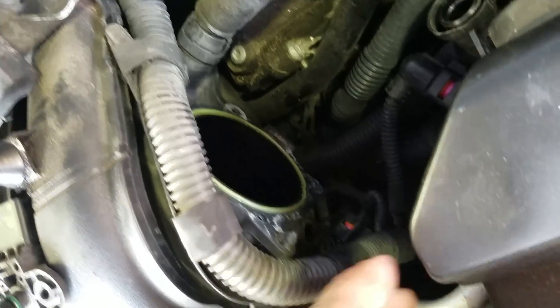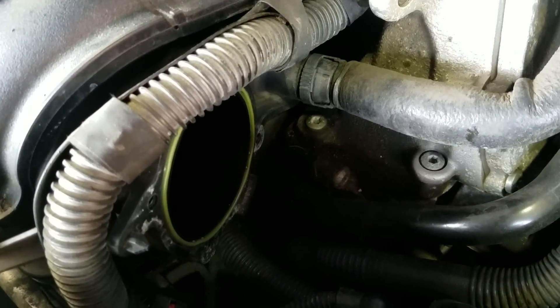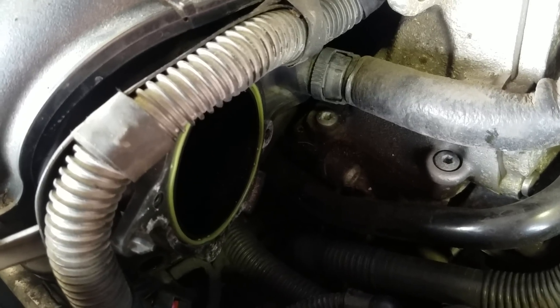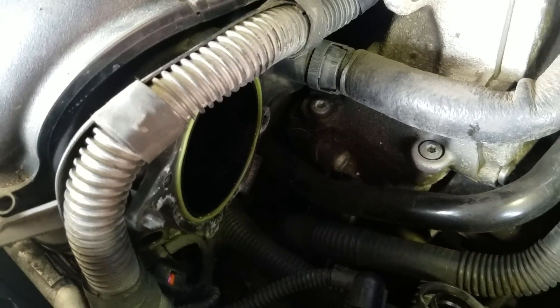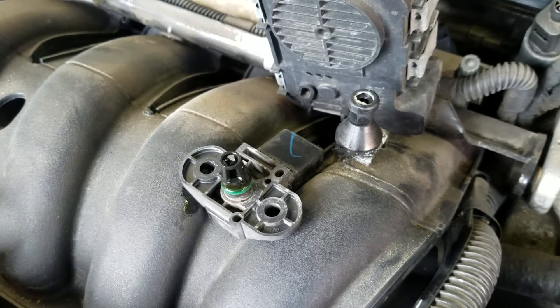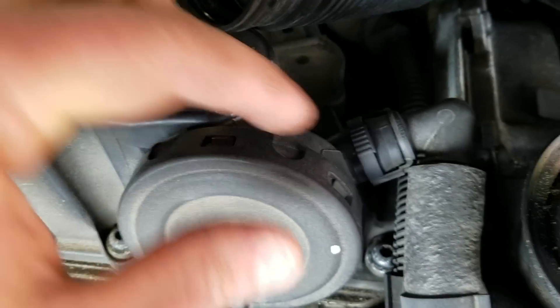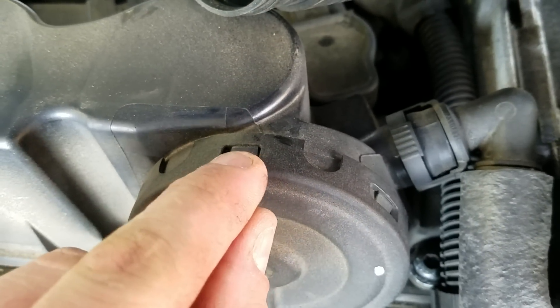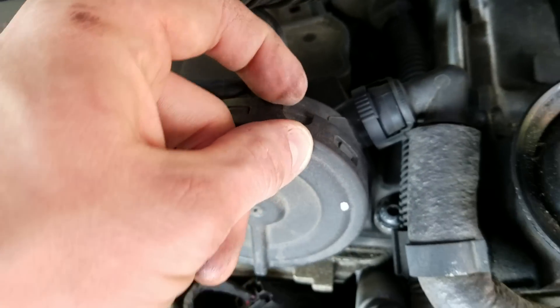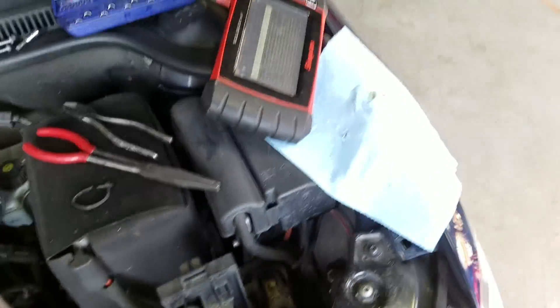You can try to stick a rag or paper towel down in the intake hole to mop things up — avoid anything with loose fibers. Clean up as much as you can. You can clean the MAP sensor with a little contact cleaner, spray it off, blow it off with compressed air. For the PCV valve, pop the cover off — there are little tabs on top. Work your way around gently so you don't break the receiving tabs in the grooves. Replace the internals from the Dorman kit, put it all back together, and tighten everything down.